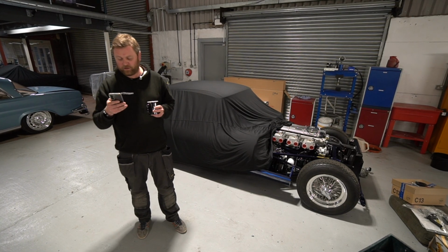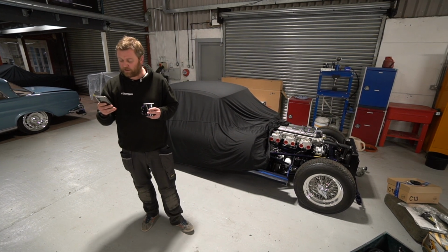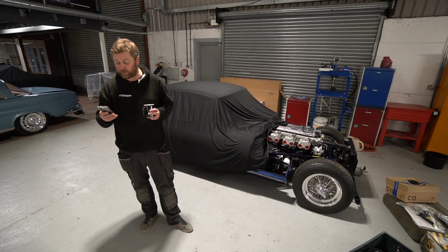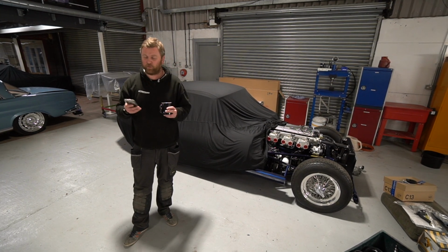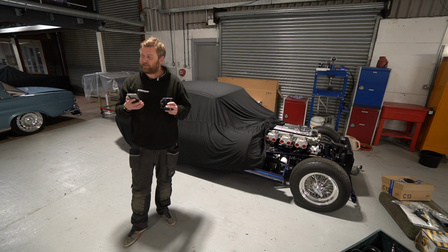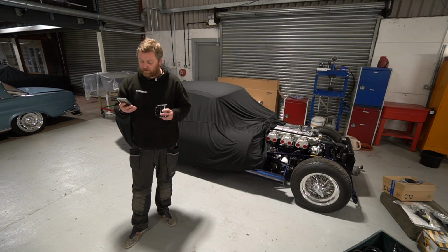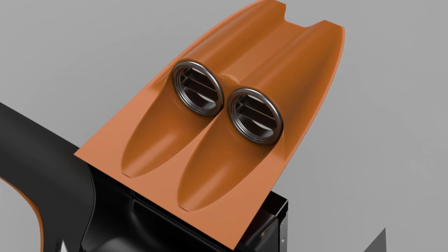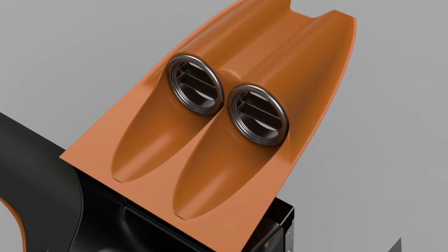This was Phil Tucker 1224. I feel like I've seen that name quite a few times. Can actual 3D printed dashboard vent parts be leather upholstered directly, or do they need to be created in carbon fibre or fiberglass? Yeah, they can be, as long as they're in a heat resistant material. We've done that quite a few times. That's one of the really good uses for 3D printers. Upholstered parts, we can make them as the final part. Obviously we can prototype them, but then we can use that as the final part, wrap it in leather. So yes, if we were going to do that dash design we talked about, where we've got the dash top with a separate insert in it that's the air vent pod, then yes, that will be a 3D printed final part.